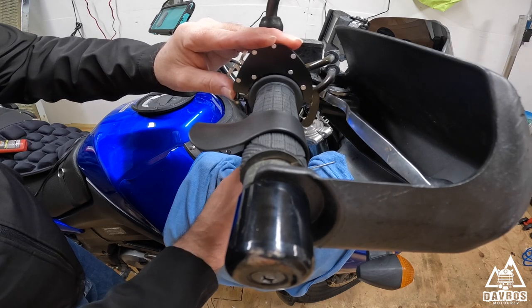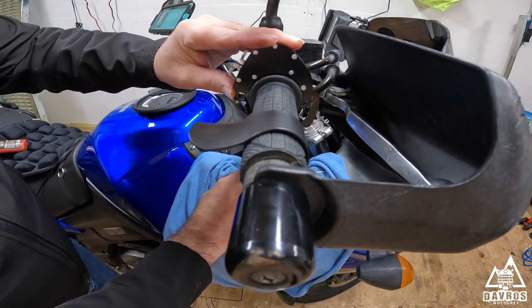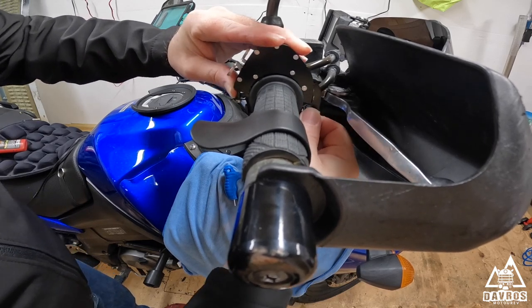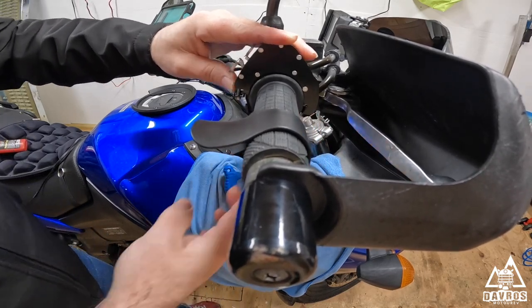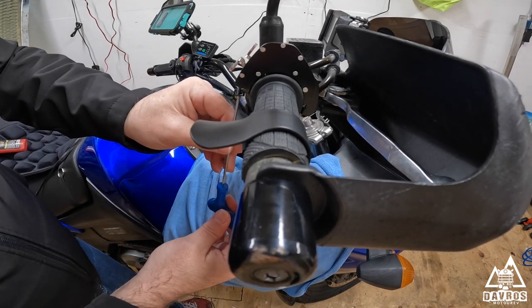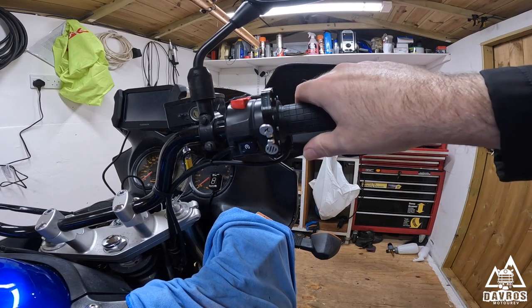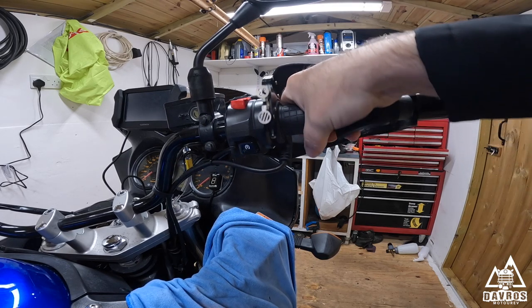It then says to push this tab here down back to the screw head, and then at the back here push and close the ratchet system - there we go - as far as you can. And then tighten this bottom screw up a little bit, so you can still wind off, increase the throttle or decrease.